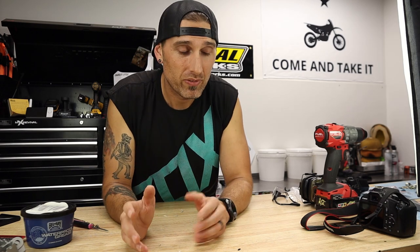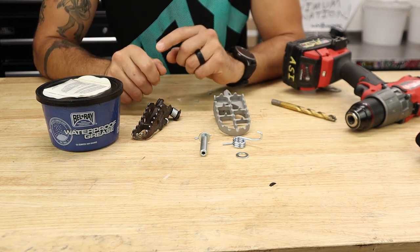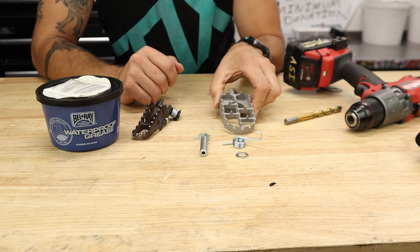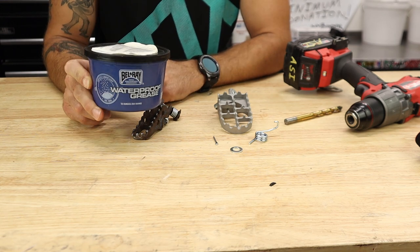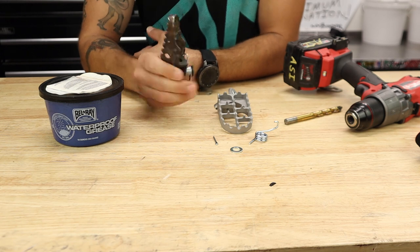If you're going to upgrade the foot pegs on your '89 or '90 RM125 or RM250, here are the tools and parts you'll need — I'll also leave a complete parts list in the description below. I used all DRZ parts: pegs, pins, washers, cotter pins, springs. Tools needed: a drill, a 3/8 drill bit, IMS Super Stock or Pro Series foot pegs for the DRZ, the DRZ peg pin, DRZ spring, DRZ washer, a cotter pin, and waterproof grease. The grease helps the bit cut faster and keeps things cooler.